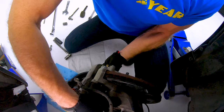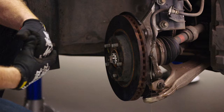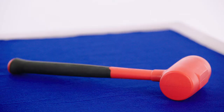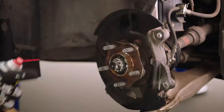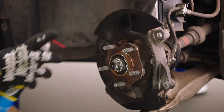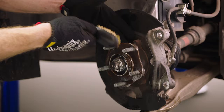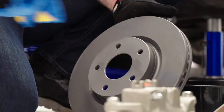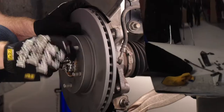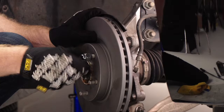Now you can carefully remove the caliper. Unscrew the brake line to completely remove the old caliper. You can now see the old rotor. You might need a heavy hammer to help loosen the rotor from the hub. Then grab a wire brush and some brake cleaner to clean all the dirt and grime off the hub. This creates a smooth surface for the rotor to rest on. We want to ensure that the rotor runs true to prevent any brake vibration. Let's grab our new Goodyear rotor and clean it off with some brake cleaner using our microfiber towel. We'll put the new rotor on the hub and screw a couple of lug nuts on to hold the rotor in place while we put the new caliper back into place.